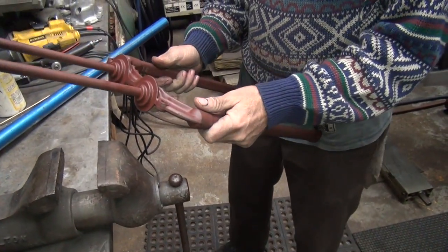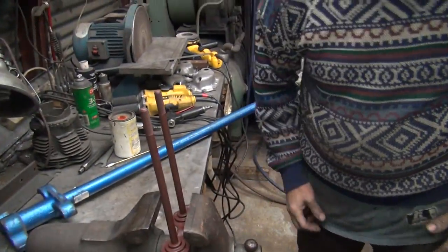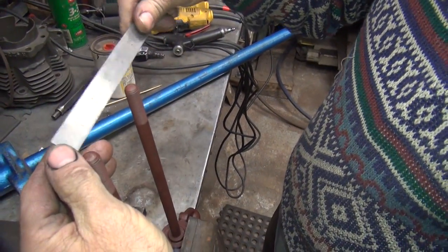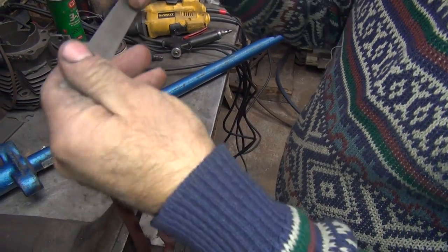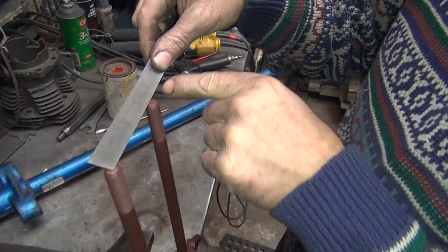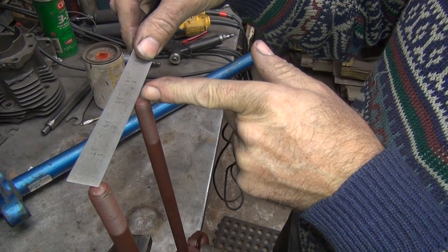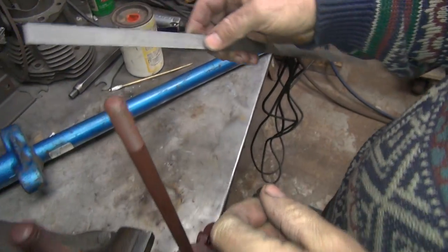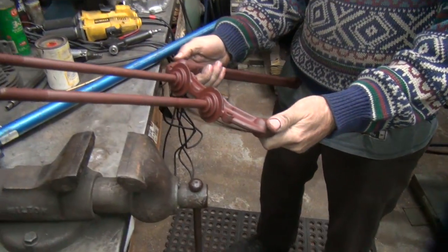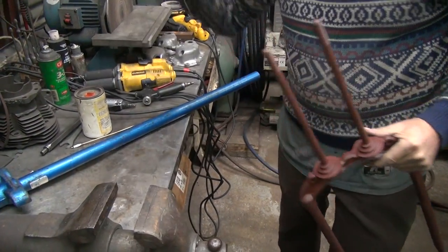Okay, now we got to get this bent to 2 1/4 inches. And we were at what number? Flip it over to inches. We're a 16th off. See, we're 3/16 over here before I moved it. See, we're right on the 3/16 mark there. So we're gonna move it a 16th of an inch. Okay. So now we're gonna go back in the press and push on this and try to get this number we need here. Take this with us. Let's go see what happens.